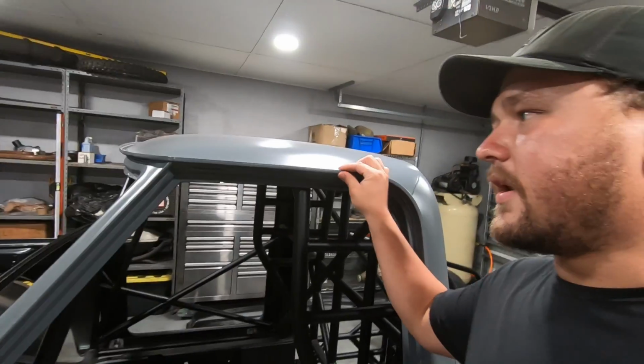And then if they do, I can go ahead and fully weld out all the mounts and start adding little additional mounts all over the cab just to keep it really sturdy. Since there's not much support left in it, you can actually move the cab a little bit. So once I verify that all that fits, we'll be able to go in and make little tabs everywhere with some nice little beauty panels that will act as cab mounts to the chassis. So let's go ahead, get the fenders off this thing, get some doors put on it, and pray that everything lines up.